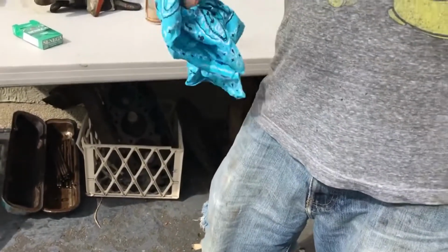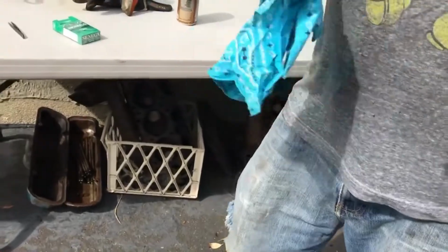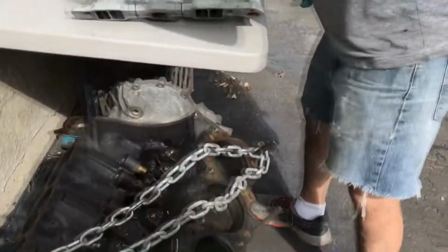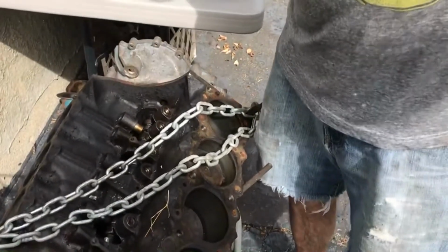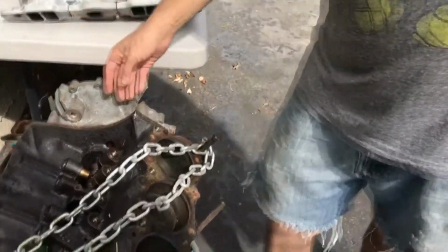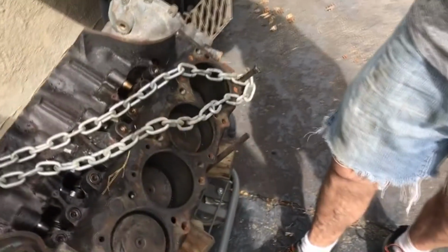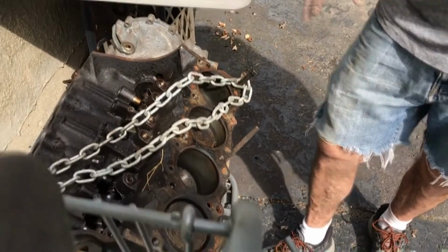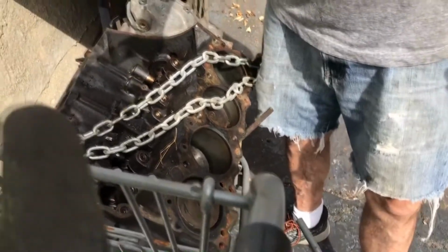Because if you want, prior to us slapping it all together, what you could do, which I'm going to give somewhat, I don't want to frighten you off, but I would recommend, being it's open, we're going to take this off. You're going to do the gasket anyway. Once you take that off, take the timing chain off. We'll check the slack on the chain. If you want to go with the chain, it's $28. Chain and gears, brand new. I'm not trying to frighten you.